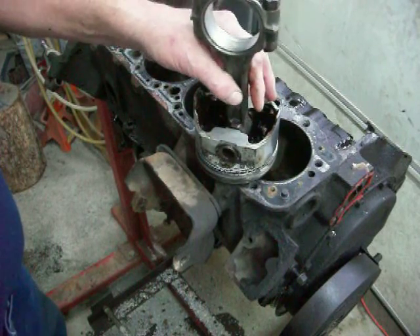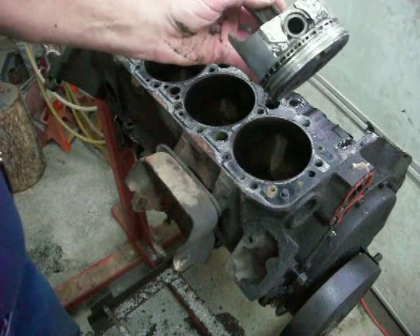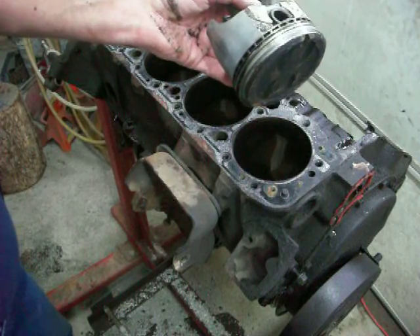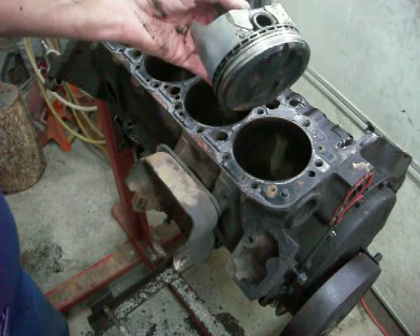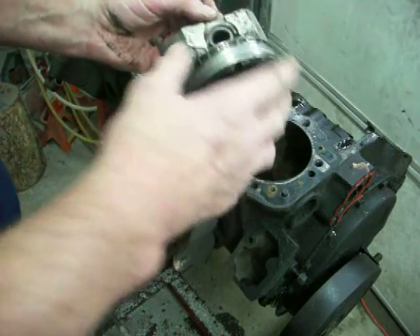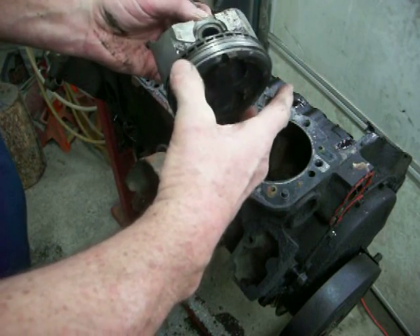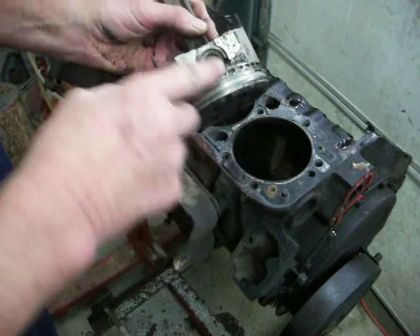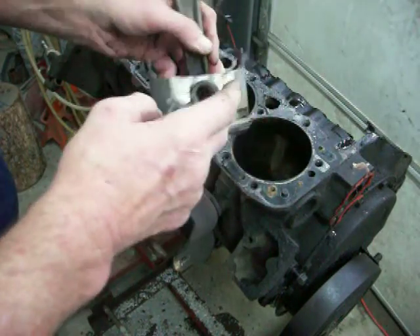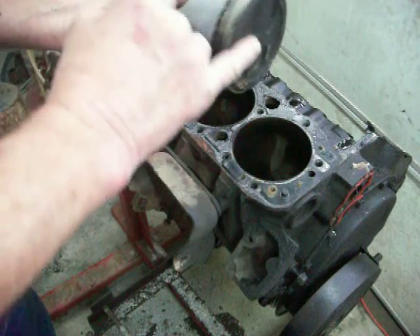This is just a short video on how you get the piston out, what to watch for, and how to mark it. If you don't mark the cap and mix these caps up, your engine could very well fail because the caps from stress and strain will take on different shapes — we're talking ten-thousandths of an inch of clearance that we must have for oil. I started to clean this one using some regular engine cleaner. I have a 20-gallon parts cleaner I bought at Tractor Supply. I'll soak this stuff in that and use a light wire brush — this is aluminum, you can get away with a steel brush as long as you're not going crazy with it.